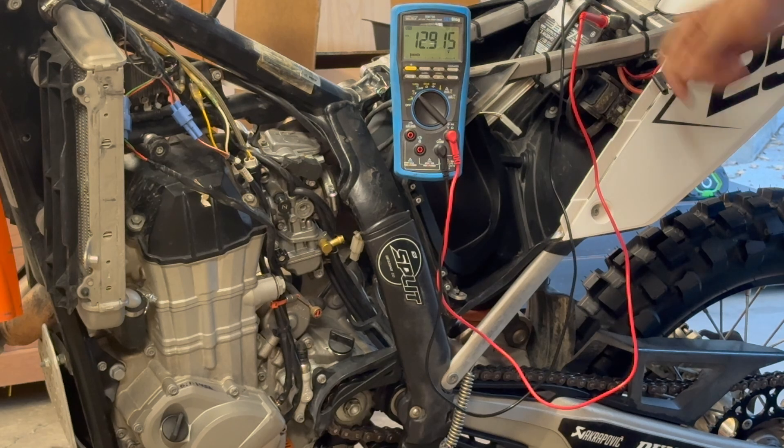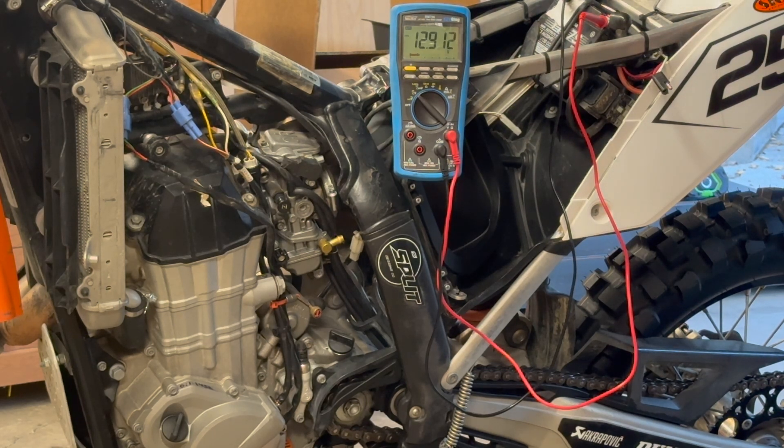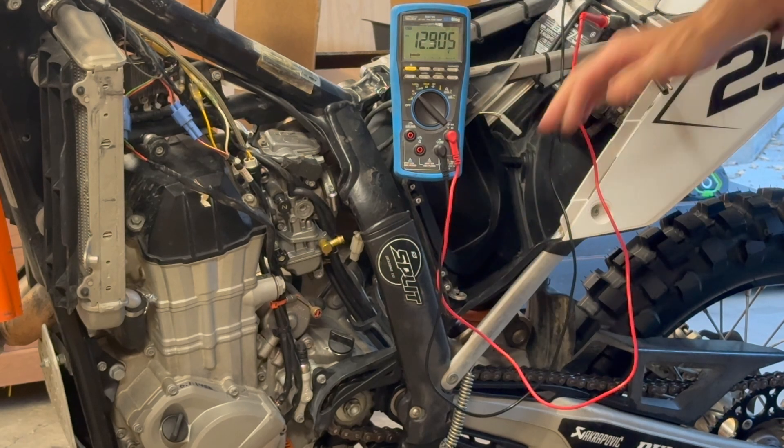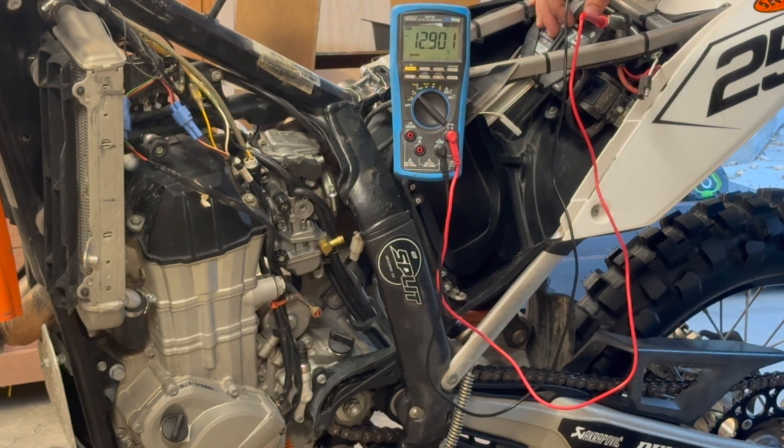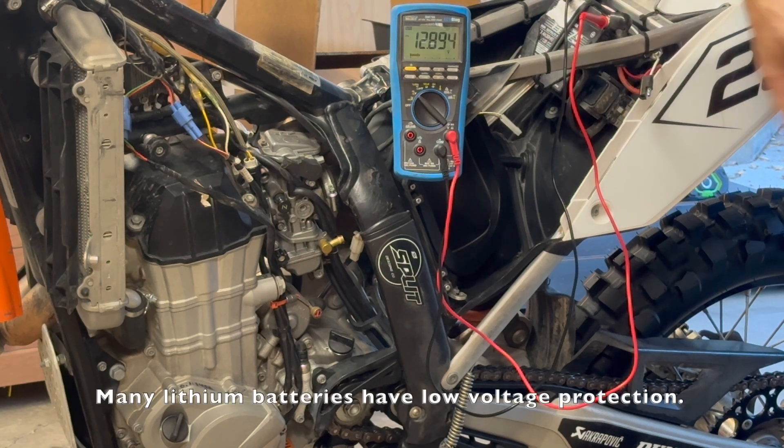The main thing I was concerned about was battery charging - I've had batteries go dead, as just about everybody has, and I wanted to make sure it was my fault and not the alternator's. So I'm going to call this charging system good as far as the DC battery goes. I'm going to be religious about plugging it in when I'm not on the bike, and I'm also going to upgrade to a lithium ferrophosphate LiFePO4 battery that has a built-in discharge protection circuit so it technically can't die all the way.